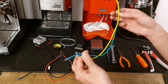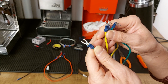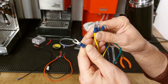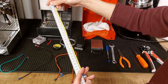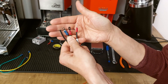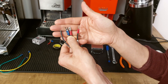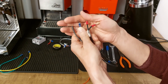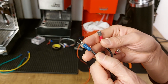The yellow and green I'm going to use to command my SSR. Notice that for the cables connecting the PID to the SSR I have four connectors on both ends. You don't necessarily need to use connectors, but it makes a cleaner installation. Those cables for the SSR in my case are 34 centimeters. Then you need two cables that will be connected to the SSR and to the terminals that were connected to your brew thermostat. This one doesn't have a connector on purpose — I'm going to show you how to crimp — but those cables should have a fork connector on one end and a male spade connector on the other end.